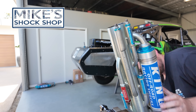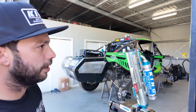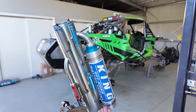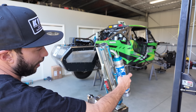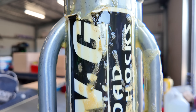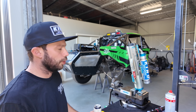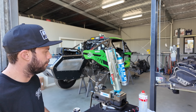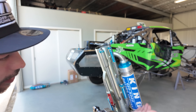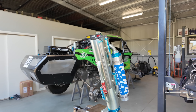When I walked in just before, the boys had just pulled this apart. What happened there? Well this one, what we call grenaded. Long story short - floating piston in here separates the oil and the gas. It cavitated or the o-rings failed. We've not done these shocks before so this is the first time we've opened them. Gas pressure mixes in with the oil and it becomes like a coke can. As the shock heats up it'll dramatically change how the shock handles, just because the pressure will change inside. And also when it's separated, there are no bubbles - that oil's clean, just flowing up and down.